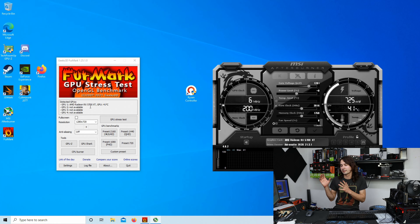So I've got Furmark here. I'm going to run the stress test until it gets up to a nice static temperature, and then fix the fans and the core speed so I can replicate it exactly the same with the backplate cut. Because of how graphics cards regulate themselves with stock settings, you can't really rely on a temperature number alone to tell you a performance increase or decrease — all it will be doing is trying to regulate the card at that temperature. If out of the box it says 70 degrees is the max, it'll spin the fans up faster and faster to keep it below that. So if we do make an improvement, you wouldn't notice it other than a fan speed reduction. What I want to see is: at the same fan speed, will it be cooler?